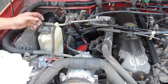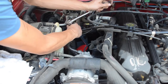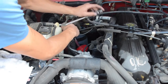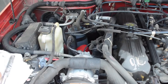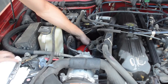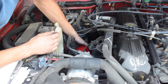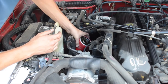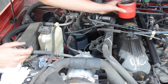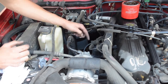We're going to start simply by removing the oil filter. I've got an oil filter wrench on there and a half-inch ratchet. I'm just going to start loosening it off. Once you've got it hand loose, you can take all this off and twist it off by hand. Make sure you have something underneath to catch any oil that drips and a rag handy. Now you're just going to set it aside. The reason you do that is so that you create more room for yourself to get the elbow off.